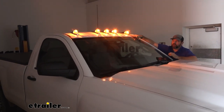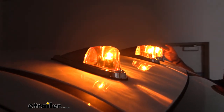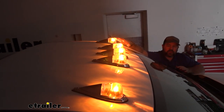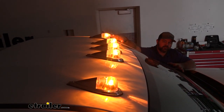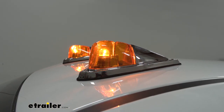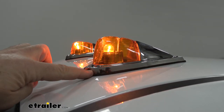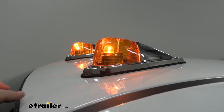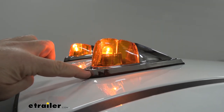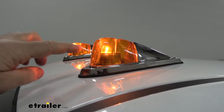These are going to be incandescent bulbs with chrome-plated frames or bases. The lenses are amber. Keep in mind that the lenses are not replaceable, so if you do crack one, you're going to have to buy another set. A lot of other lights I've installed have two wires that come off the bottom of the bulb — one is a ground, and you have to try to get it underneath one of the screws. With these, it's going to be a single wire, and because our base is metal, when you run the screw through the roof, that light is actually grounding itself, so we don't have to run that extra wire.